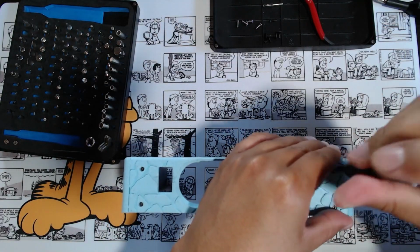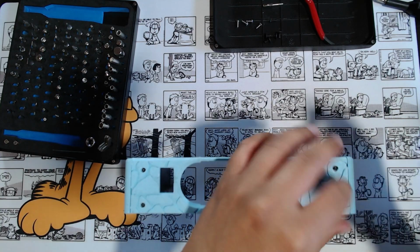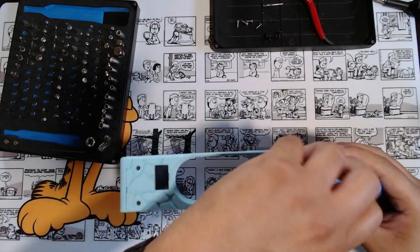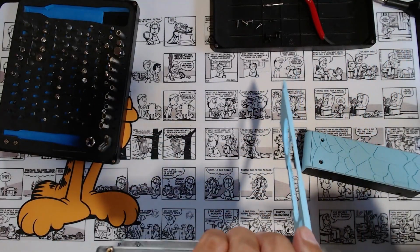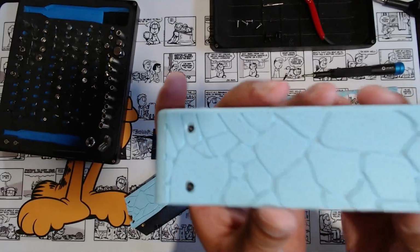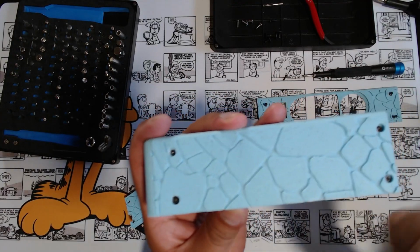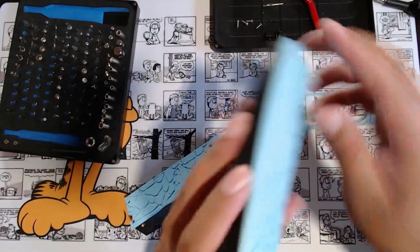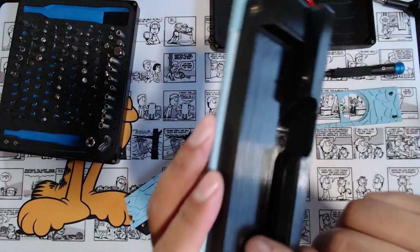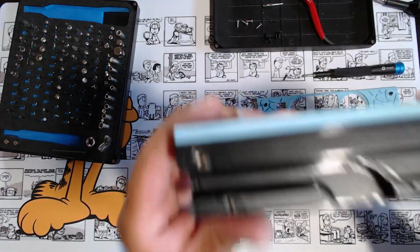There are no brass inserts for the walls. You really need to think about what orientation, what position you're printing your pieces in. But when I printed these walls here, it had to print like this, this side down, this facing upwards. Not print it like this, because otherwise you would see lines going across like this. All those print lines, like for example on here, you can see all these lines going horizontally. So that's how you know the print was like this.